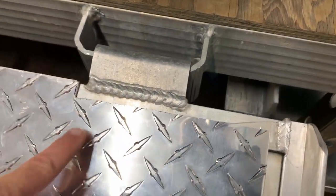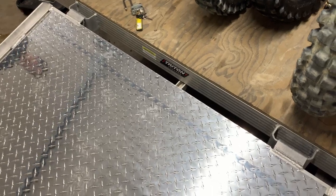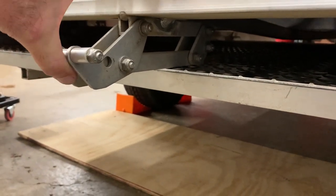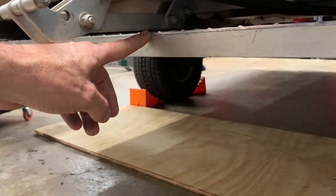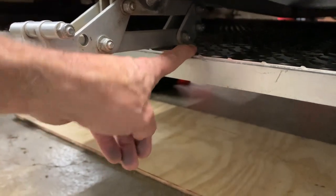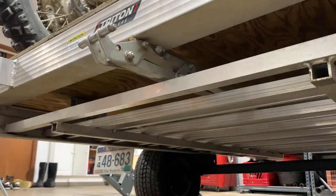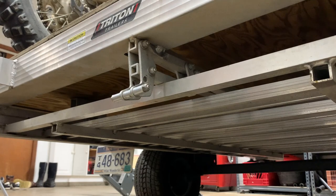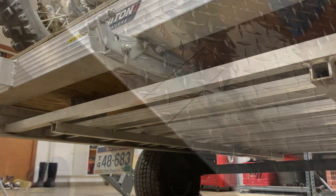We cut it a little strong but that's okay — we got plenty of space and we still have good bearing, and it looks like it's gonna work. The next step would be to put the fasteners in. Well, we ran into our first problem. The way this trailer locks into place is that this would push down and then it would slide right over top. Because we have another eighth inch thick plus the diamonds, this is now not going down all the way. We took the diamond plate off just to see how the mechanism works — it does push it down probably about an eighth to a quarter of an inch, so it kind of bows it down quite a bit.